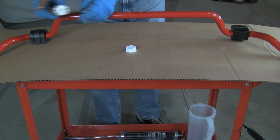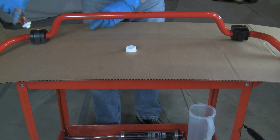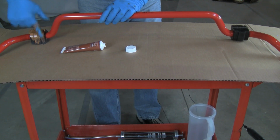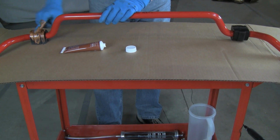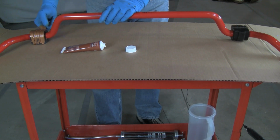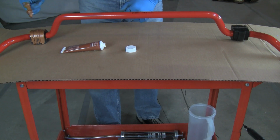Now also, our metal bracket goes on top here. We're going to apply the anti-seize to the outside of the bushing, so we're sure not to get any squeak between the bushing and the bracket either. Okay, so now this one's ready for installation. We'll complete the other side, and then we'll show you how to put the bar right back up.